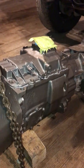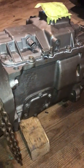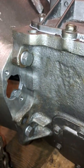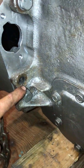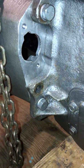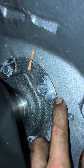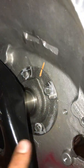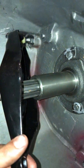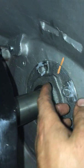I've got a 1995 NV4500 transmission, and if you do the research, the 93 to 95 has a different case — it's Chevrolet only, I believe — and the input shafts and retainers are different. I had to re-drill my holes for the bell housing, and before you can do that, you have to install your bearing retainer first, because the hole is almost perfect to fit. The bell housing is actually up a little farther compared to a Chevrolet on the 95 case. This is possible as long as it's a 95 and you have the same gear ratios as the later models. If you have the low gear version, you can't do this — you've got to change the gears.